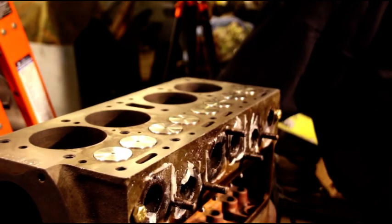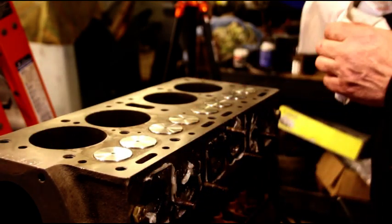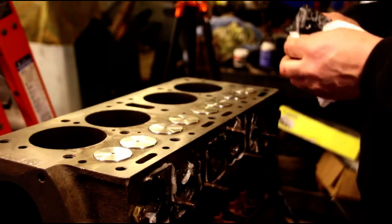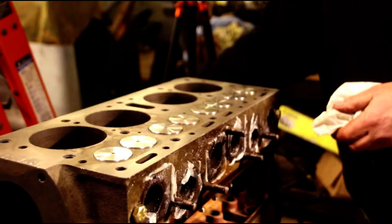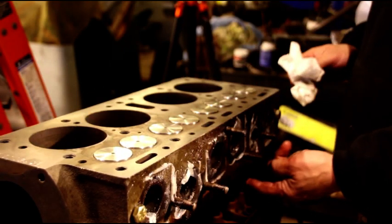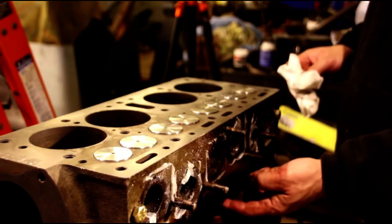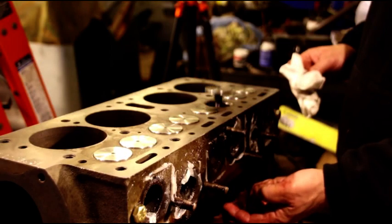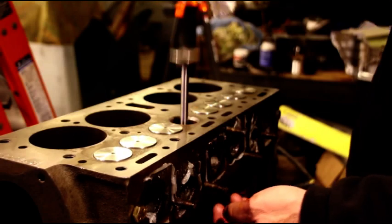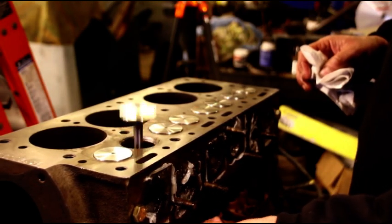You need that in these engines. These engines are only 60 horsepower — if you start losing power anywhere, the Jeep's not going to get out of its own way. Another thing I've showed plenty of times: when you pop that valve up, it should jump like that. See them jumping? The only way a valve is going to jump like that is if you have your three angles cut right — they should pop like that.